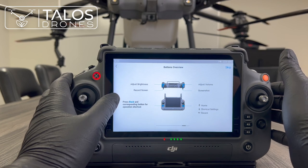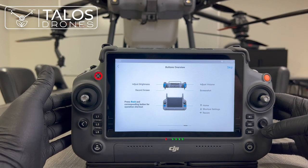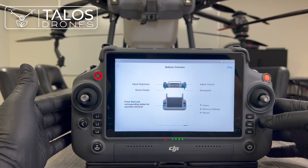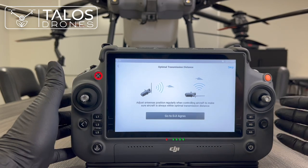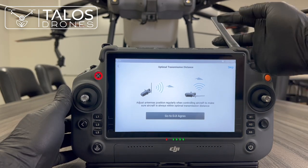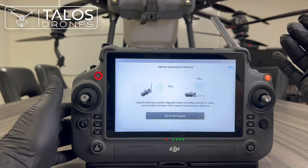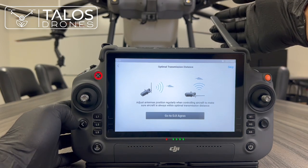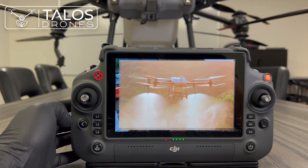Here it shows that moving the home button up gives you home shortcut settings and recents — similar to the T20, T30 buttons. An important tip: you always want either the front or the back surface of the remote controller facing the aircraft for the best connection. A lot of people think the signal transmits from the sides, but it actually transmits from the front or back surface.